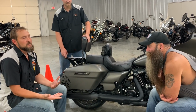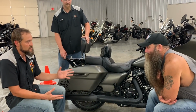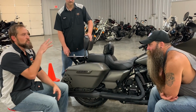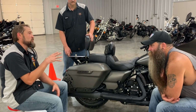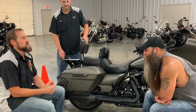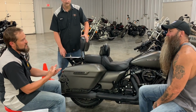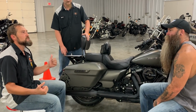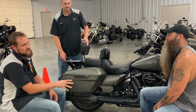And something to talk about when I mentioned dyno, the dyno that we're doing with the auto tune system: we put the wideband O2 sensors into this, which helps give the computer more information than the narrowband did before, and gives us more options. But we throw it on the dyno not for full out dyno drags or something like that. We put it on the dyno for exact learning. So I can run this bike through a 10% throttle learn. My throttle hand doesn't know 10%, but my computer does. So I can run it through the entire map and make this ECM learn as efficiently as possible.